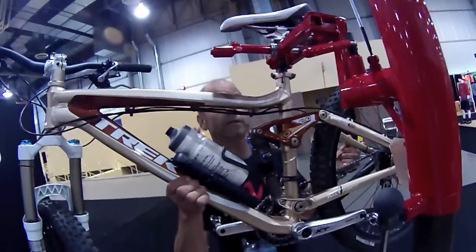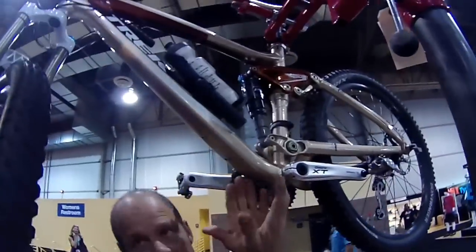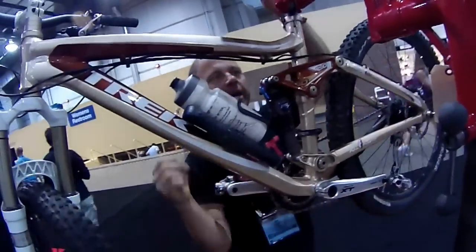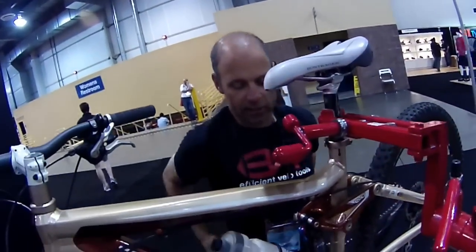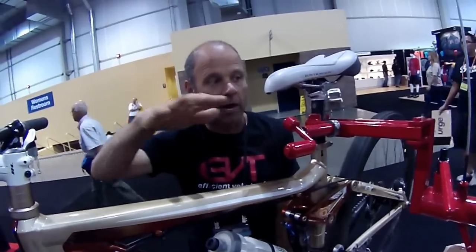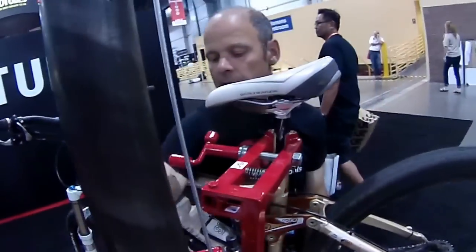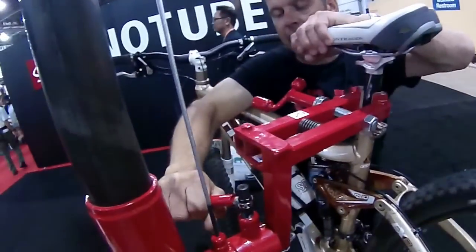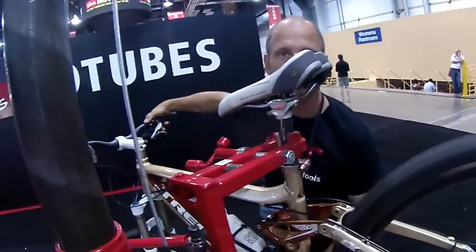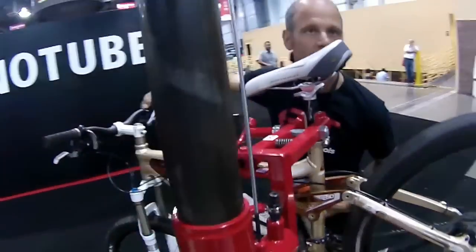You can go clear up to here if you need more scrutinizing, reading serial numbers, etc. The beauty of the stand is it can allow you to have a straight back for any working height. So if I'm checking the gears of the bike, I can say this is a little too high — go a little bit lower, lock it down, tilt the nose down using the rotational binder, and then I can very comfortably check the gears.